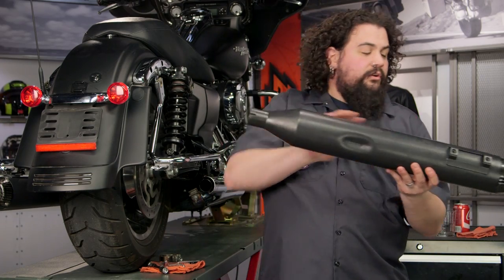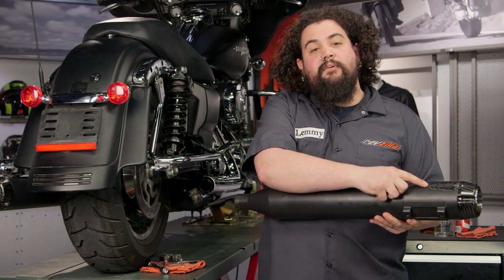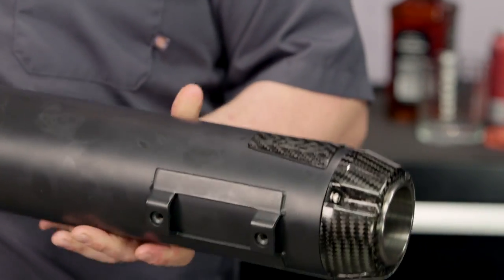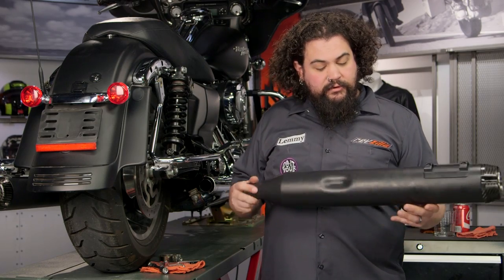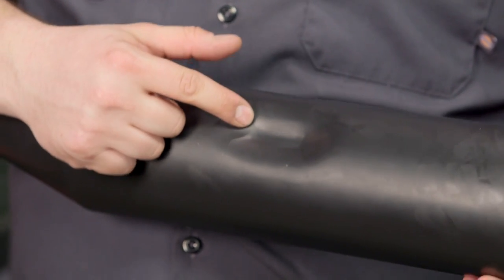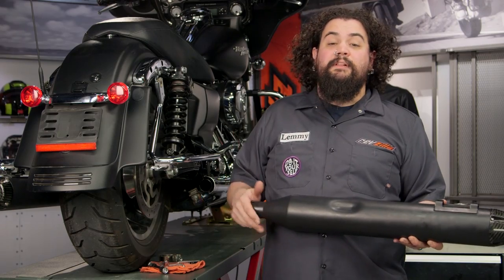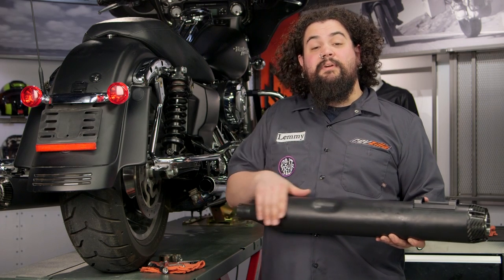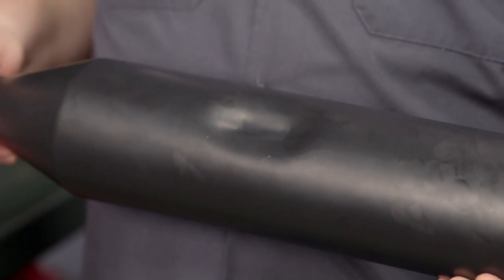Once you get your new muffler, take a peek at how it gets oriented. This particular muffler has some branding that makes it evident which side goes to the outside of the motorcycle. However, not every muffler has that. So look for this indent — this dent is to help the swing arm clear when it's moving up and down so it doesn't wreck the mufflers. It's really important that you get the right side on the right and the left side on the left. Otherwise you may damage your brand new mufflers, and aside from looking goofy, people will see that dent pointing out and wonder why it's there.